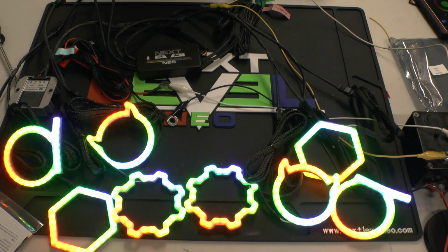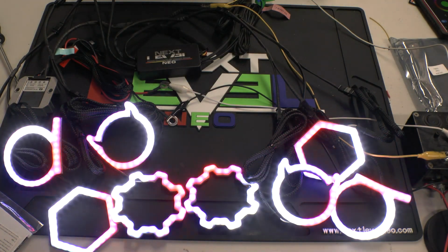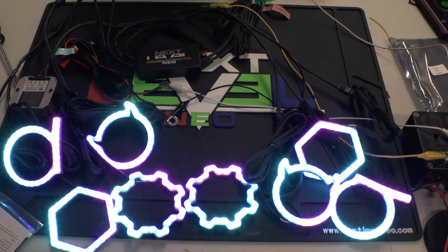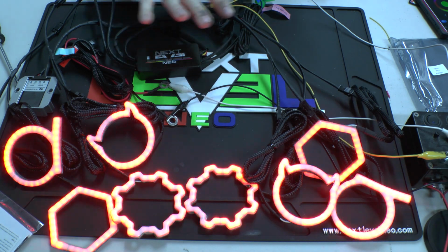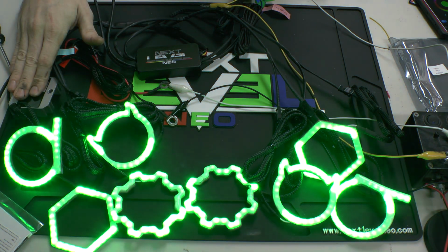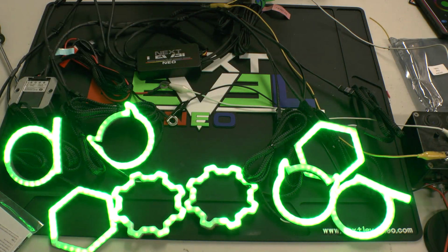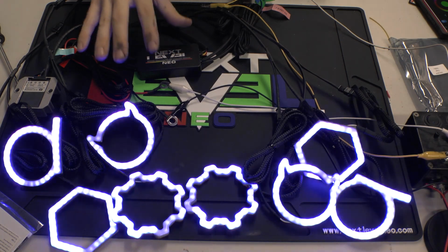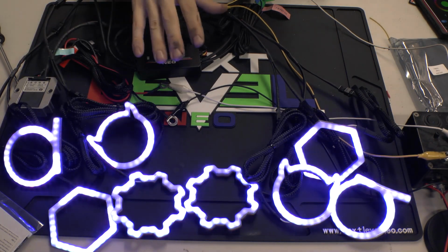Not compatible with our UCS lineup at this time, or at least anything 12 volt in our UCS. Our UCS pods would be compatible, being that they are 5 volt. But it is not compatible with 12 volt, and that is simply because the plug and play aspect of this does incorporate a 5 volt. So on a technical side, if you are a little more familiar with electrical, you can run UCS with this setup, but you will have to run a separate 12 volt to that UCS.